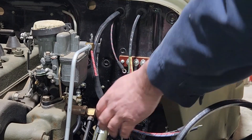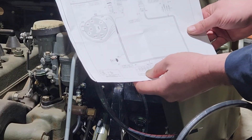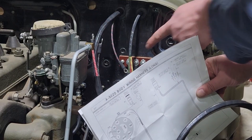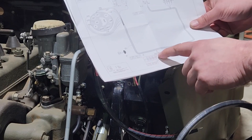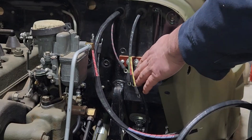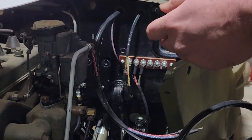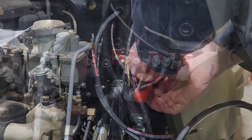The headlight switch is mounted and what I'm looking at is the schematic that comes with the harness. It has a six-position junction block and it's showing where everything should be hooked up. I'm going to go ahead and connect these wires as the schematic shows, and I won't tighten all this yet because there are a lot more connections that need to come in through here.